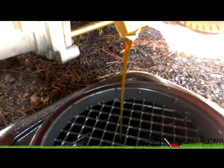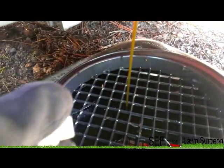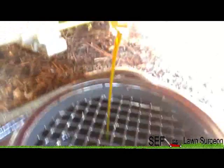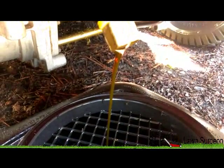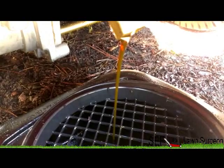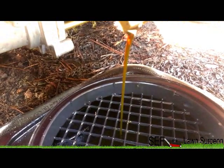Then I came back here to get this drain plug out. Here's the plug right here. Somebody had it super hand-tight too, so I had to struggle to get this off. But now that we got it off, I'm letting the oil drain and then I'm going to take off the filter and go from there.